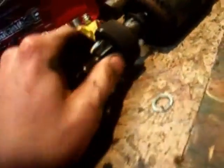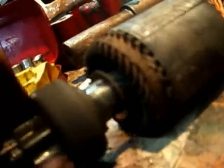So yeah, that hasn't got any signs of grease left on it. The bendix assembly has a small bearing here which has a lot of play in it. So I'll just have to clean everything up basically first. The armature's not too bad, it'll do, it'll come up nicely with a bit of steel wool polish. You just have to make sure you don't leave any residue on it or do anything too harsh. So anyway, that's where the fork sits, under or in there, so that it pulls it in, sucks the gear in and out of the starter, or in and out of the ring gear, sorry.